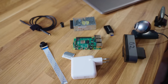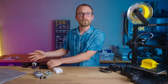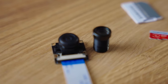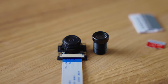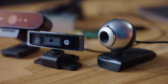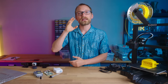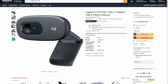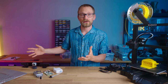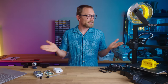That's all the hardware you actually need to get OctoPrint running, all linked in the description. But if you're setting up OctoPrint, you probably want a webcam feed too. There are two basic options: getting a USB webcam or a Raspberry Pi camera module. The Raspberry Pi camera is fantastic value but you'll need to print a mount and enclosure for it. USB webcams are a bit mediocre for image quality but more convenient. The standard recommendation is the 720p Logitech C270, though most off-brand webcams work fine out of the box. If you want something proven, get a Raspberry Pi camera or the Logitech C270.